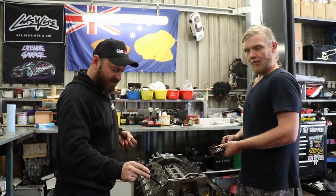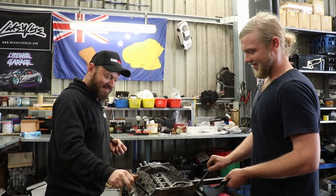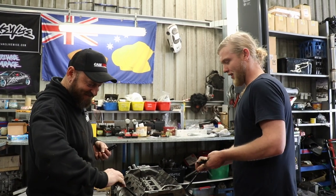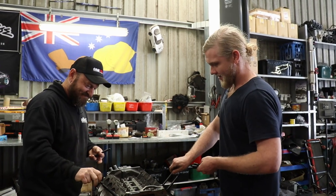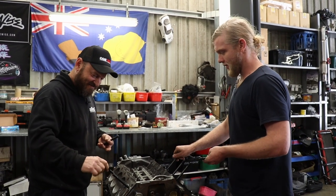Got another helper here — this is Jackson, everyone. I went to school with Jackson, he's a dead-set legend. There are two different length head studs in this case — long on the top, short on the bottom — so don't put them in the wrong place. These particular studs have shoulders on them, which is not always the case. With some Japanese stuff you just screw them in until they bottom out and sometimes have to fill the hole with ball bearings to get them even because they don't have a shoulder.